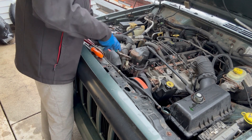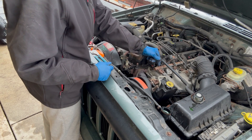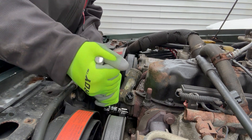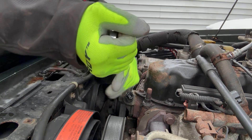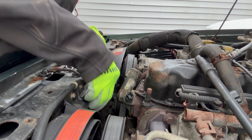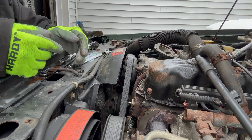That's kind of crappy. There's a temp sensor there too. I'm going to go get feeling back in my hands and then pull the thermostat housing off. This is definitely much easier on a TJ. The housing is crusty — very crusty. I'm going to have to spend quite a bit of time cleaning this thing off. I'm going to have to get a scraper, get the gasket off, and then we'll see how that thermostat looks.